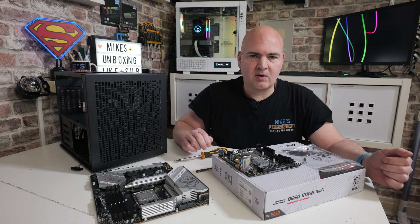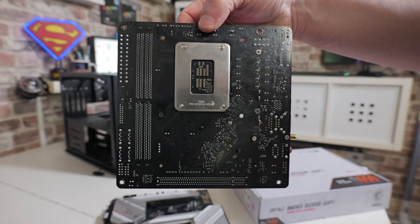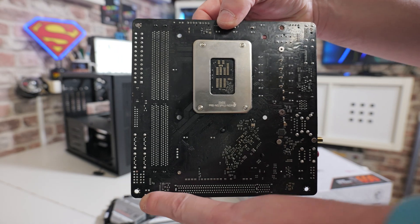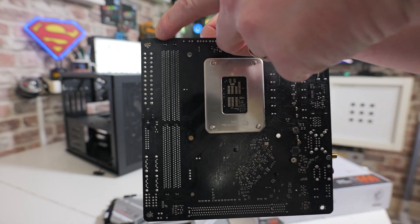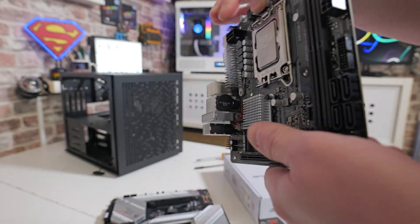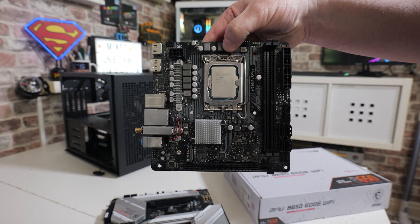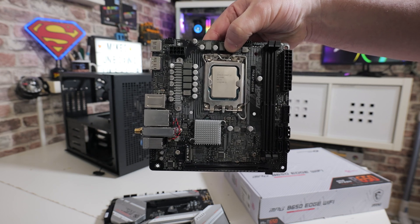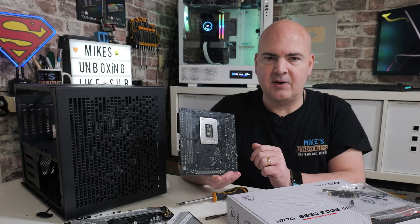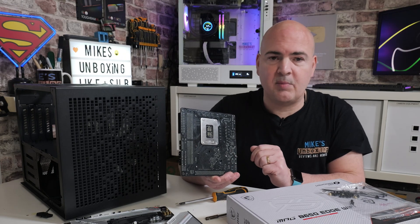So before we get into the individual layouts, let's take a quick look at a motherboard so you can get an idea of why you need these pillars. This tiny little board here is what is known as an ITX or Mini-ITX — this is the smallest form factor motherboard. Now if we take a look at the back of the motherboard, you'll notice there are lots of little sharp contact points. These are residual bits from where things are soldered onto the motherboard, and they are all generally electrically conductive. So what happens when you put something electrically conductive slap bang against some metal in your computer case? You get a short circuit.